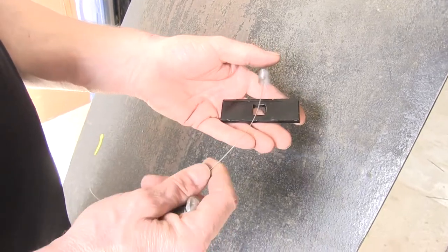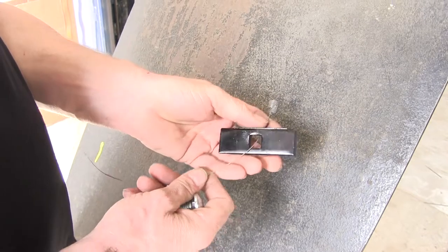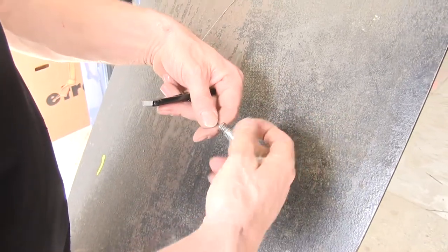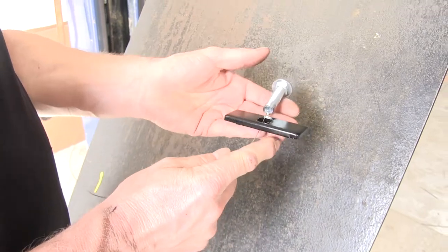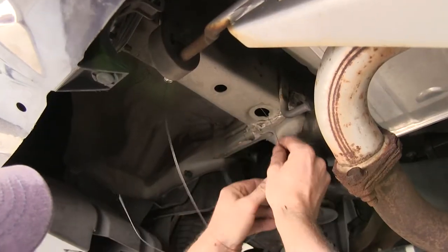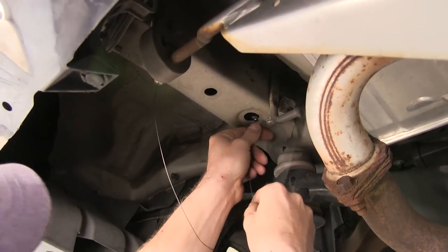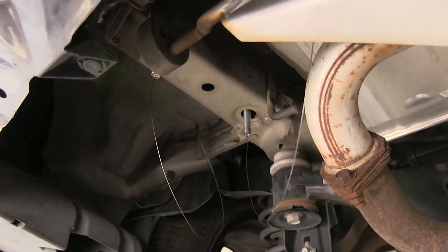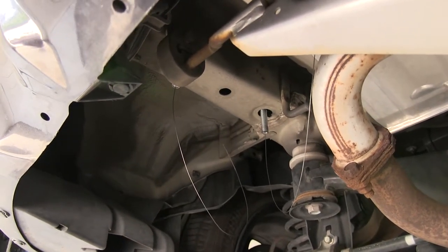For the hardware that goes down the hole towards the front of the vehicle, we're going to do everything on the outside this time. Bolt leader through the block, thread on the bolt, and put this whole assembly into place. Push the bolt in, lock, and then pull it back through. That'll do it for our driver's side — we'll do this one more time over on the passenger side.